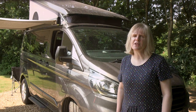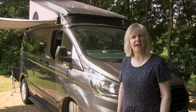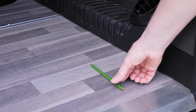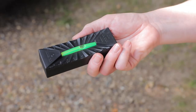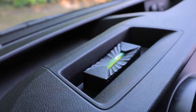There are a couple of things that make levelling easier. After a while it's difficult to tell whether things are correct or not, so something to show you when they are is a good idea. The water in a glass will give you a level surface to work with, or a round pencil will roll towards the lowest point. But a spirit style level like this can be left in your van ready for your next trip — put it somewhere you can see it from the driving position.